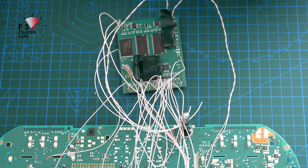This part does take a while, so take your time measuring correctly, snipping the end of the wire to cleanly remove the sheath, then tinning that end. I also like to tin the pins on the board before finally soldering them down. Repeat this process for the next few wires on the grey plug. Here's a close-up of all the connections for the grey plug — there are quite a few to solder before you stick that grey plug on. Once that's done, the rest of the wires can be fed through the original Audi TT Mk1 cluster housing and routed to the green and blue plugs.